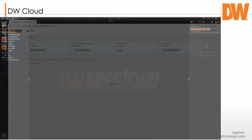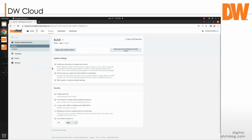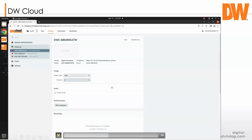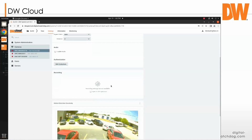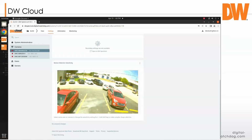Okay. And when we go in and click on one of those, click the CX, and we're going to see our settings. We can do almost all the setup that you can from the client locally on the machine here. We can activate, deactivate licenses. We can check on our cameras. Change the credentials. And if we scroll down here, we can even set the motion areas in the camera when using the motion detection recording. So almost everything can be done in the cloud.